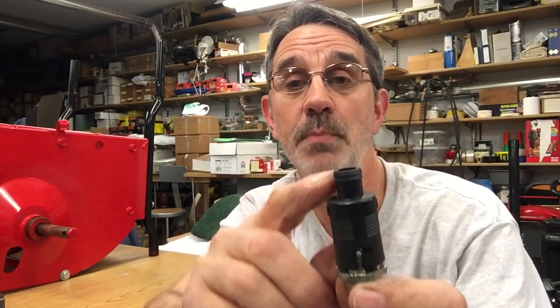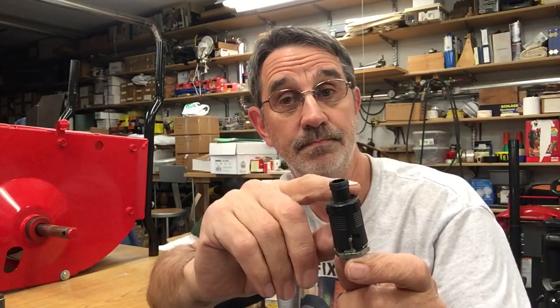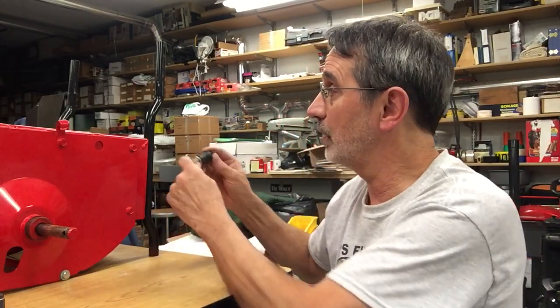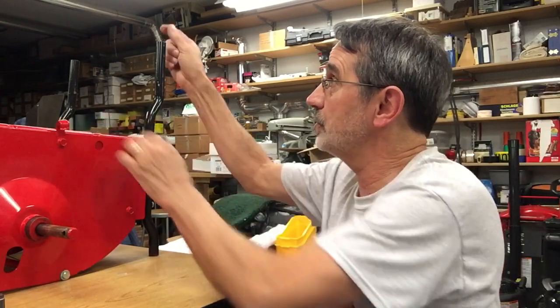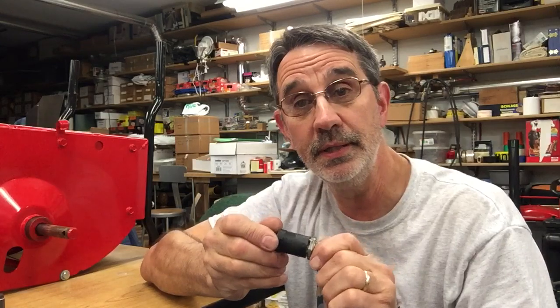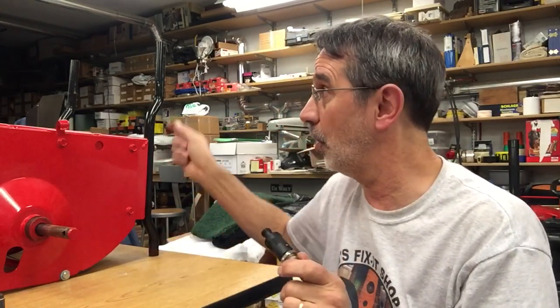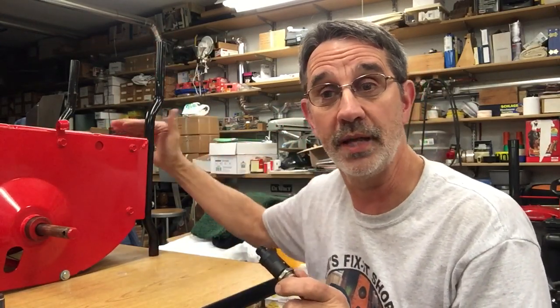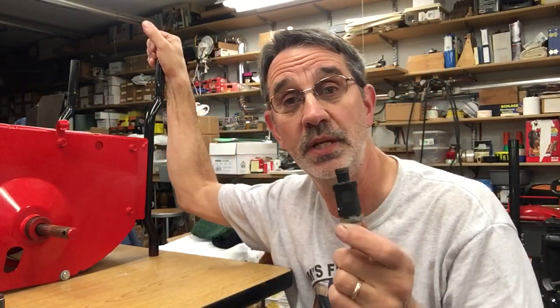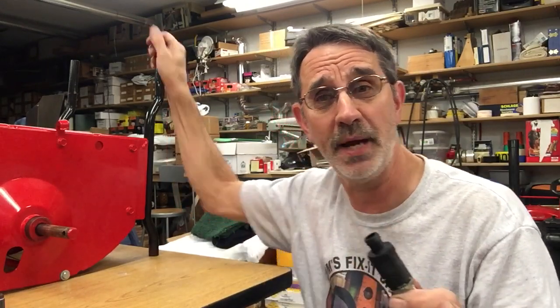They thought this was a wonderful idea because this is made so you can put a hose on here. Hey, that's great. My boss's machine I rebuilt, he had one of these on his engine, and it had a hose on it that went up and clipped. So if this came open, it wouldn't leak because the hose was up above the oil level in the engine. And it had a screw-on cap on the end of the hose to keep dirt out of it. Awesome idea.